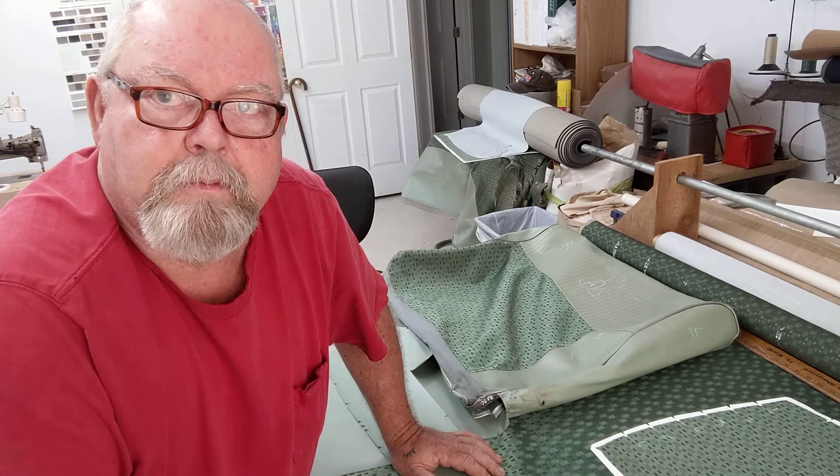Come back and visit us, possibly tomorrow. We'll be sewing up some of the cloth as well. It doesn't get any backer on it — it'll just fight us, and that's not the way Ford built them. But we have to make sure we pad out right — do the right depth of not only foam, but then cotton over the top of the burlap, and jute behind on the springs. We'll keep producing these hopefully every day until we finish this project.